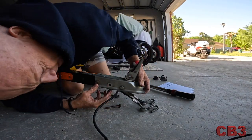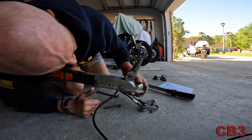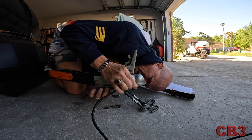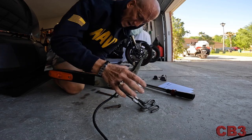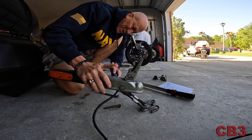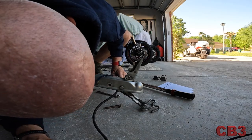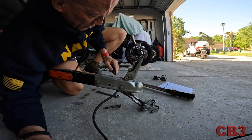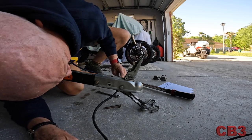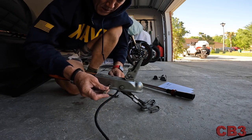So all I've done is I've taken this bottom coupler bolt out. I'm inspecting to look at everything to see how it all looks. It looks fine. No real metal fatigue. There's a lot of grinding and stuff that goes on on this part of the trailer — that's where all your pressure, all your points are. So then what you have to do, you have to make sure everything's lined up. I've got a little screwdriver and I'm going to line up my cables and a little spacer in there, get them all lined up, and then I'll just push this right back through here.